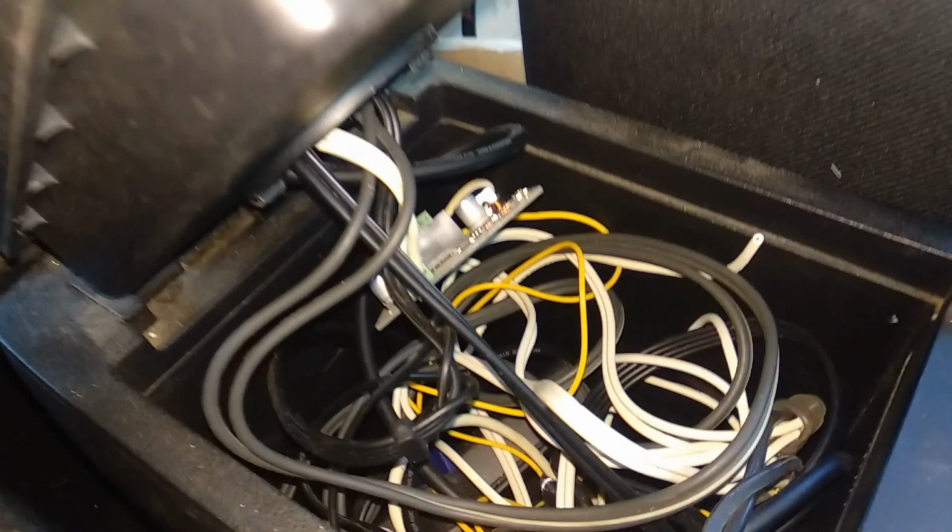I reckon it'd probably sound fine without it, but I got it just to have it. And also that thing there has a remote turn on, so I can use it just like an amplifier with a remote turn on, and in fact it outputs a remote turn on, so that board in there actually turns on the rear amps. The way that turns on is it's got a constant power going to it, and it's got a power coming from the ignition, just like a regular amp, and it outputs,